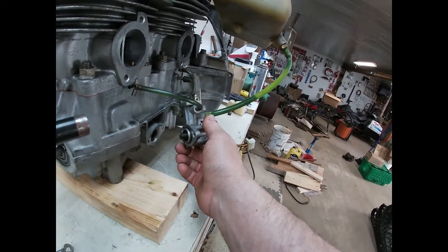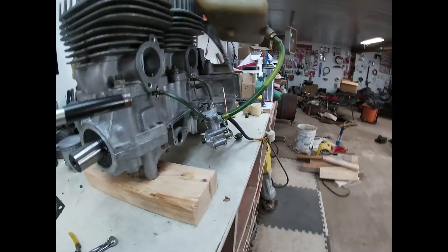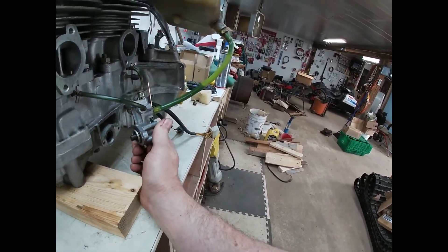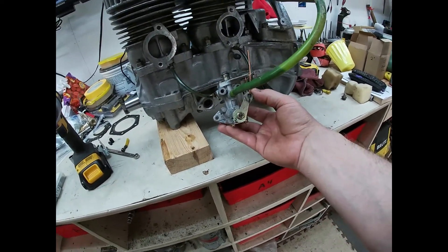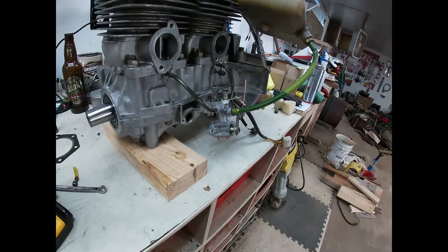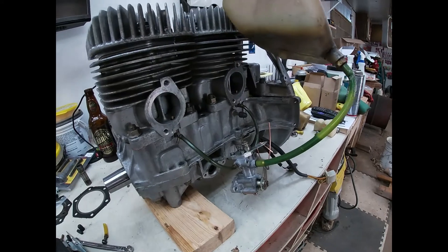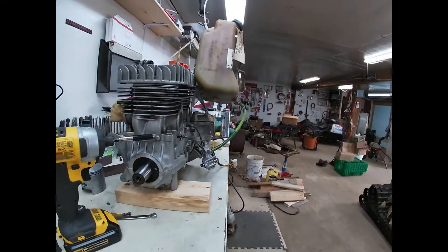On the backside of this pump you want to spin it counterclockwise. Wire the throttle up, turn it all the way up, and just spin it and you'll see it pumping oil slowly up these lines into your ports. Just want to make sure they both are pumping good.